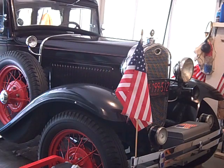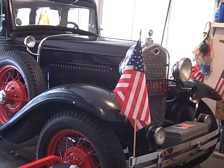If there's any movement at all, you've got to replace the sector shaft bushings. Again, the bushings don't cost much. They're just little brass bushings. But it's a big job getting the gear out of the car, taking it apart, driving the old bushings out, and putting new ones in. But don't buy a car where that thing is loose, because it'll just leak the grease out of the gear. The bushings really should be replaced. It'll cause slop in the steering wheel, and it won't be very much fun to drive. Find a club member who knows this area of the car, and he can help you. You might be able to find somebody who will do it for you, but you should learn how to be your own mechanic. Model A is pretty simple.